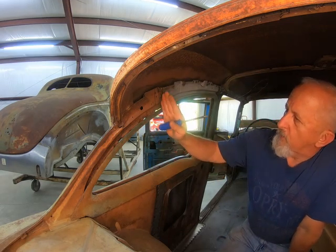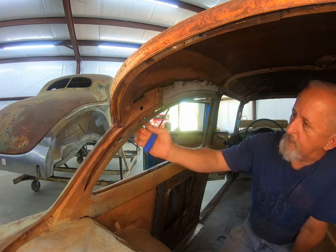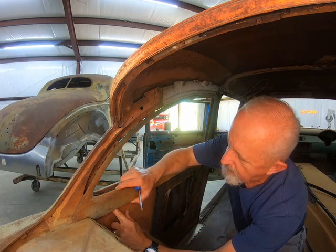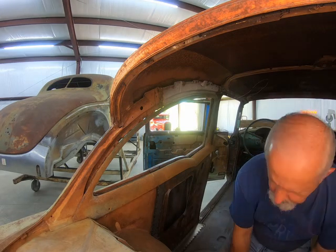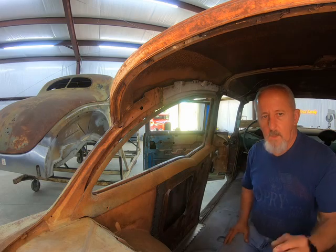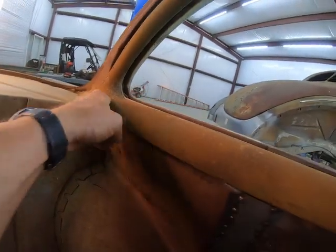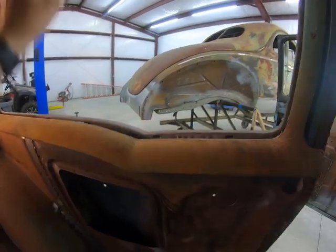The four-door is a four-door from here back, so it doesn't have the same tab that the front part has. I'll just have to weld something in there to screw that. This hole I should be able to line up — I'll just have to work with it, drill a new pilot hole and start the screw in. These are self-tappers anyway. Looks like it's going to work — that'll look good, that'll be like a two-door should. Fits real good, fits the opening good.